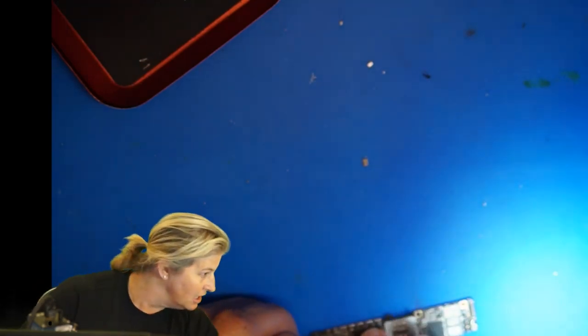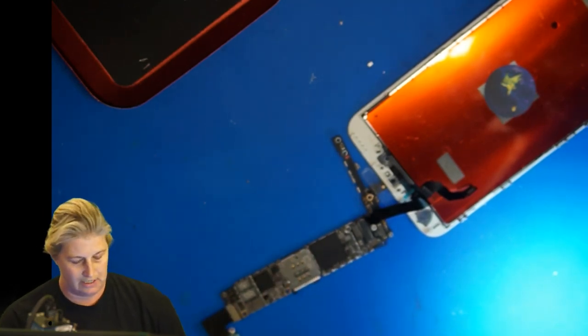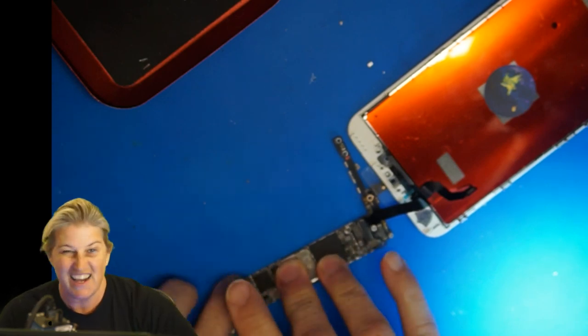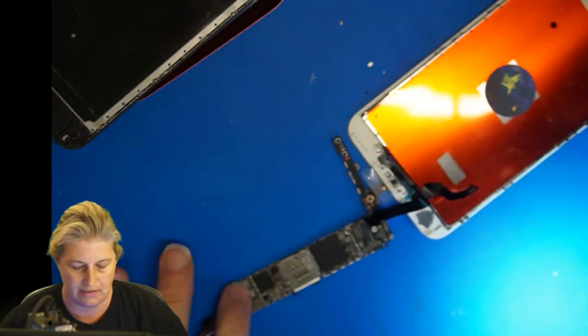Let's stick this screen on here — it's really giving me a hard time. There we go, screen is attached. Hello from Dubai. Now let's flip it around and attach a dock. I'll attach the DC power supply — this is kind of like a battery applying a battery voltage, but I can see what's going on with the current consumption. This is not the native screen — rule number one: you don't have a board problem until you know you don't have a parts problem. I know this screen, dock, and DC power supply will work.